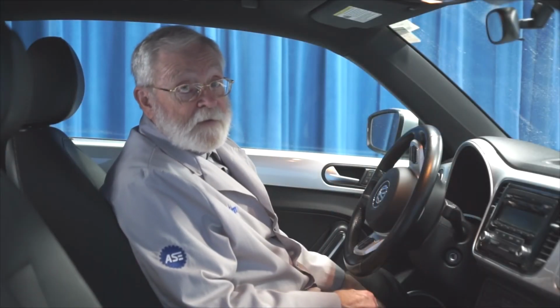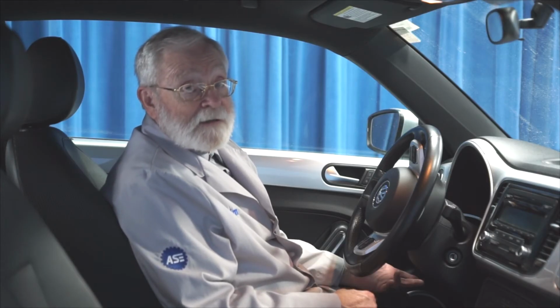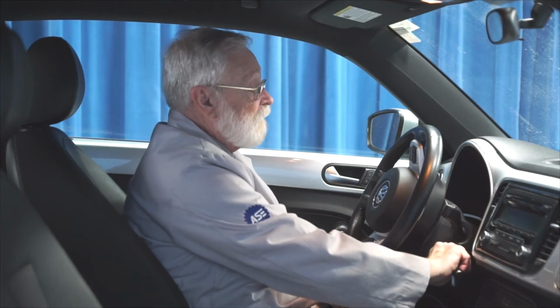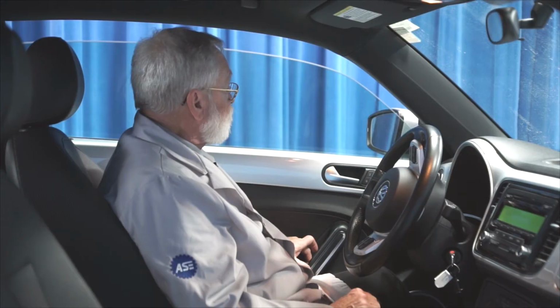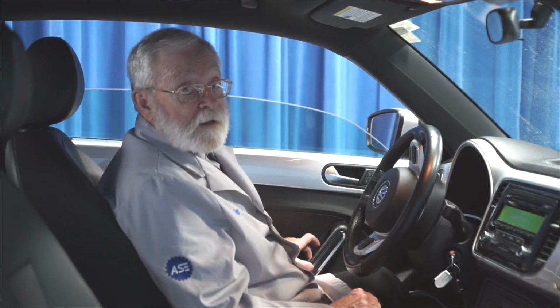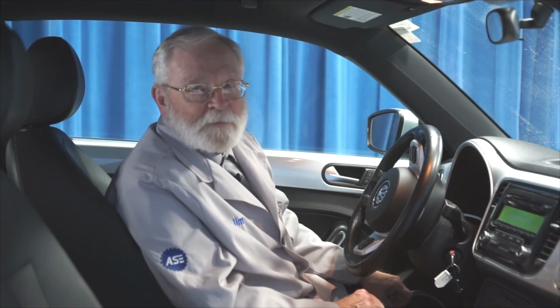Be sure to continue to follow the step-by-step instructions for the vehicle that you're working on, because some models will require you to turn the ignition switch on, then off, and then on again. Also, some vehicles will require you to put the windows all the way down, and all the way back up. And some vehicles will require you to drive in a straight line at about 9 to 12 miles per hour or so to reactivate the steering angle sensor.